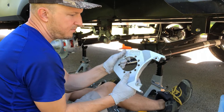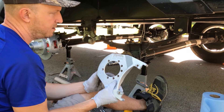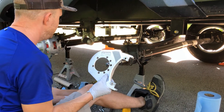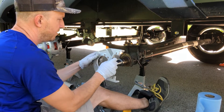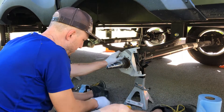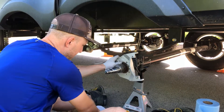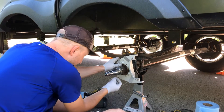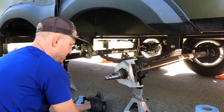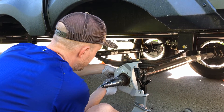This is your brake holding plate. It clearly has 'outside' stamped into it, meaning it goes to the outside. For my axle weight and trailer type, the recommendation is that the pads are always to the rear, whether on the left or right side. I'll put it on carefully — it's got multiple holes since it's the same plate for both sides. Use the nice new bolts provided, add the lock washer, and tighten up the nuts.